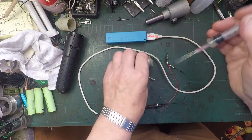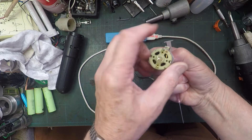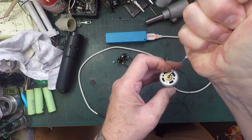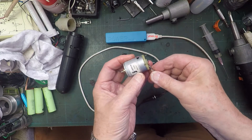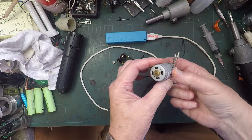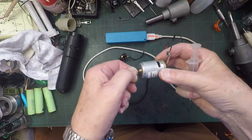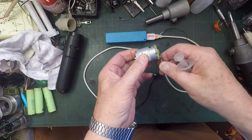That's a micro oiler. So we'll put a tiny little bit of oil on that end. And we'll try and get a little bit of oil on this end. These are not bearings as such — they're just brass bushes. That's a little bit of oil. And then we'll try... that's the plus, and this is the minus according to the markings on it. Not that it really matters — I don't think the motor cares one way or the other. That's definitely starting to sound a lot quieter. I don't know if it's going around a bit slow. It stops with ease. No, something's still not right — there's still something wrong with this motor.